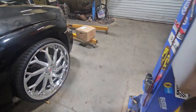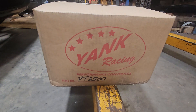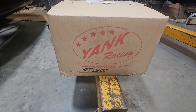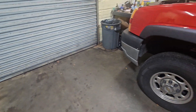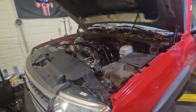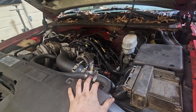I see they have PT 2500 on the converter this time, so I guess they loosened it up from the 2200 to the 2500 stall. My transmission guy still has it, so I don't know when he'll be able to get it done. I really need to get this truck back together.